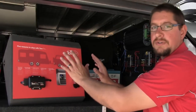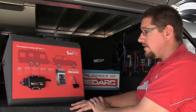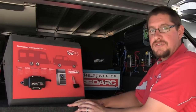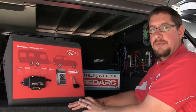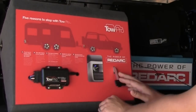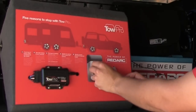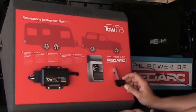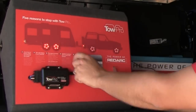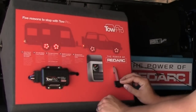The whole vehicle and trailer system all brakes as one, giving you a nice smooth progressive braking. The user control mode is really great for off-road applications where inertia isn't necessarily the best way to detect braking force. To enter user controlled mode, we stop the vehicle, set the controller to zero, put our foot on the brake and double tap. The LED is now green. User controlled or manual mode is purely triggered by the brake lights — as soon as the brake lights come on, the trailer brakes come on to the set level on the control knob, and it does not consider how hard the vehicle is braking.